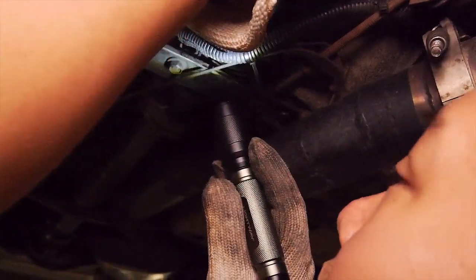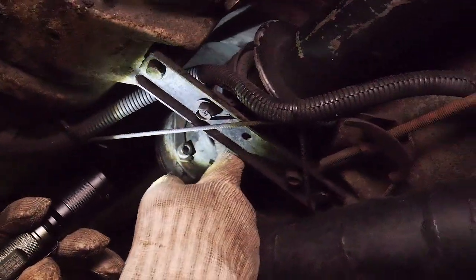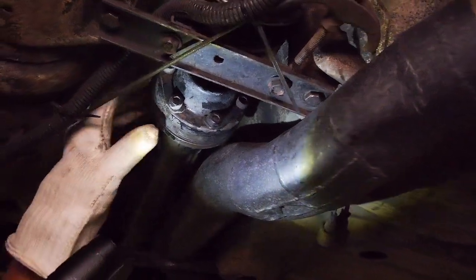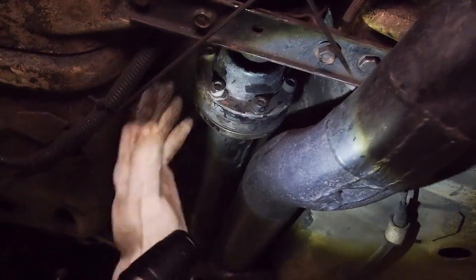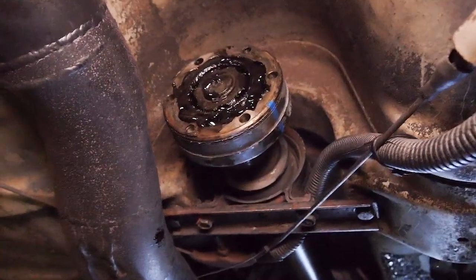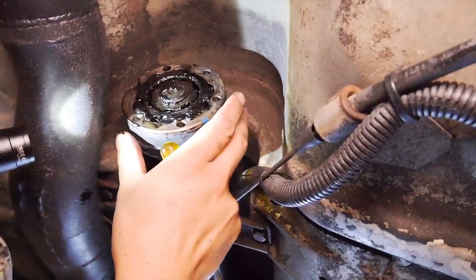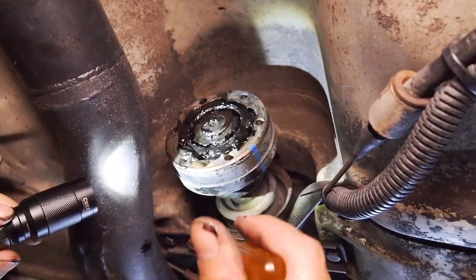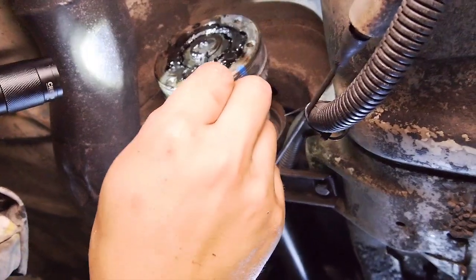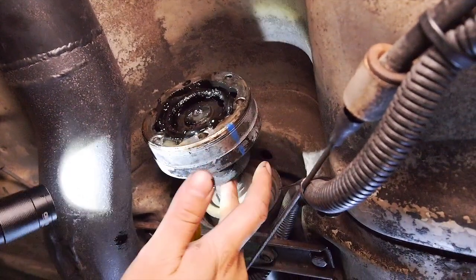We can pull this CV joint partly apart - just take the cover off by taking these bolts out. That rubber's not doing anything, so it's not sealing out water and crud from the road getting into that joint - we might see something quite scary inside. We've got the centre bearing apart - it's definitely seen better days. The grease is all burnt, got water in it potentially, metallic speckles - plenty of metal particles. And it looks like it's had water in it before - you can see the circle around here is all red and rusty. The seal at the back there isn't sealed to the shaft - it's just sliding around.